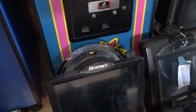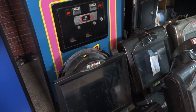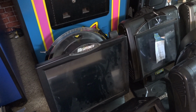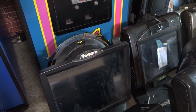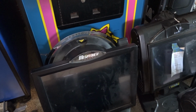They're cool, but just like with my other Aurora, same thing. It was loose as a goose and in really rough shape. So I'll take that apart and tighten it all up. Usually, there's a little... what's the word? Not gimbal, but there's a spring in there with the actuator that gets loose, and then where the actual joystick rod fits into the gimbal or whatever. I'm screwing up the word there, but basically that little area gets worn out because it's just plastic.